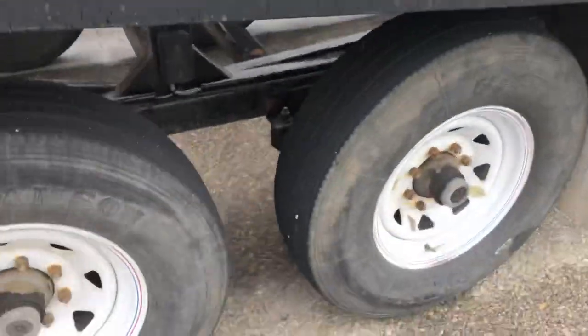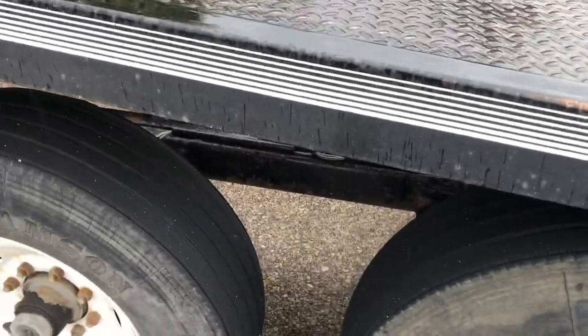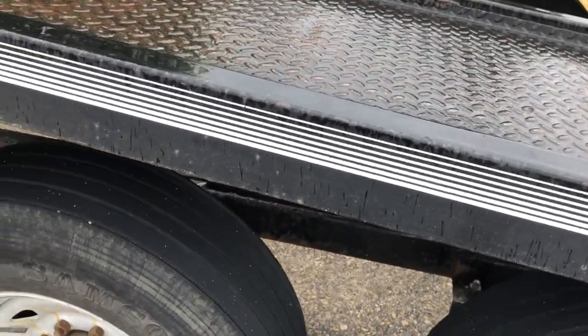I was told to look at the 5 o'clock pin on the 7-pin harness and give that wire power. It's been raining all day. I said, nope, I'm not going to give that wire power. And then as I went down, I said, hey, you need a brake controller. And I looked at my truck, the brake controller location, where the wires go. I obviously didn't have a brake controller. I was like, wow, this can't be that simple.